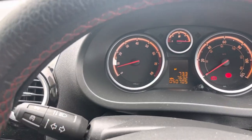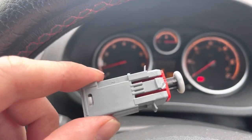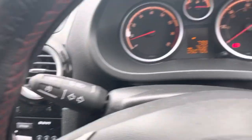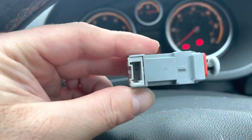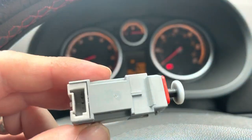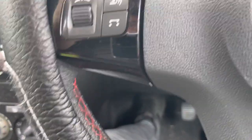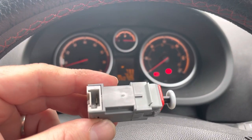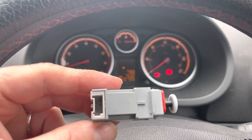Even if your Corsa hasn't got cruise control, a lot of Corsas still have these switches. And if your cruise control is not working, it is this as well. They just plug in — little plug socket on the side — and it just clips in underneath your clutch pedal. So change that and that will sort your Corsa from revving when you change gear. Thanks for watching.